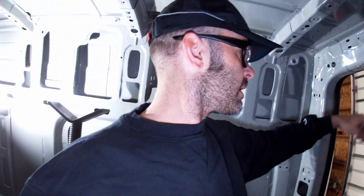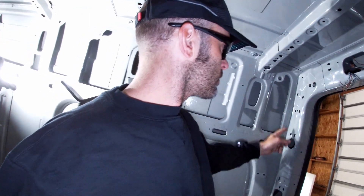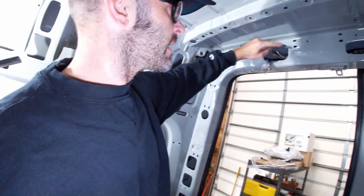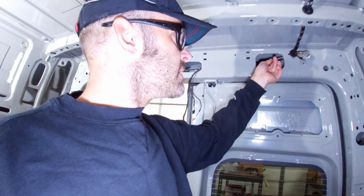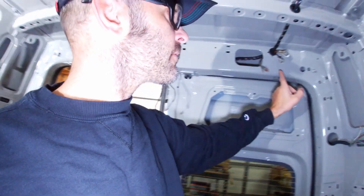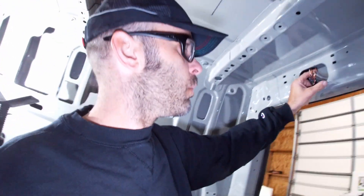Once that cover's off, I pull the wires out to a location where I feel comfortable cutting them. I only cut the wires that drop down to the rear taillights — that's this side right here, which gets cut right where I can pull it out of this rectangular opening in order to re-solder the wires together and shrink wrap them. On the driver's side I cut the wires where I can add on to them, pull it back through, and make a solder — so there are two solder joints on that side and just one solder joint on the other side.